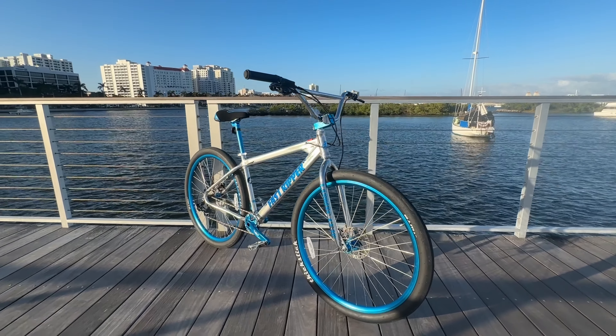The next thing I'd change is the tires. Slap some Hookworms on there — Thick Slicks are good commuter tires, but for those who want to be swerving and cutting up fast, Thick Slicks are not the go-to tire. Definitely throw some Maxxis Hookworms on there. The stock Fast Ripper comes with a 32 tooth front sprocket and I'd probably change that to a 34 tooth just to get a little more top speed. I like to pedal really fast and with the 32 I feel like I'm running out of gearing.